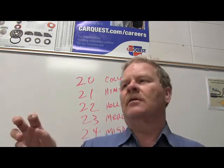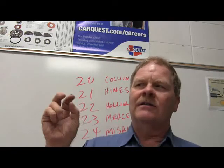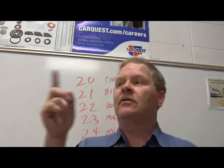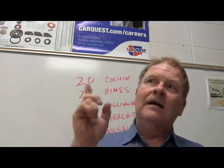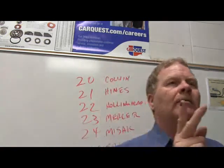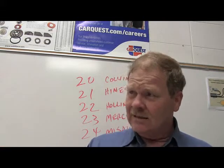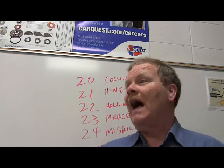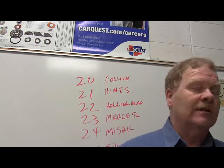Well, hydrocarbons, when it unites with oxygen, if it gets enough oxygen, it winds up being carbon dioxide. You got two molecules of oxygen, one molecule of hydrocarbon, you get carbon dioxide, and there's nothing wrong with that, it's just fine. If, however, the mixture is a little too rich, and you've got one molecule of carbon and one molecule of oxygen, you've got carbon monoxide, which is poison. I could fill this room up with it. You couldn't smell it, you couldn't see it, but we would all die if it was in enough of a concentration. That's what you got to pay attention for, is carbon monoxide.